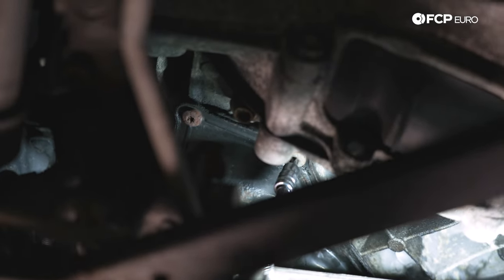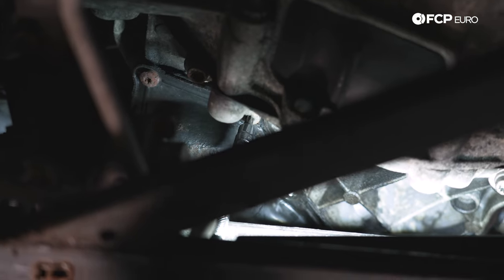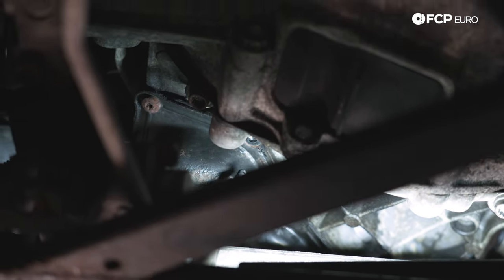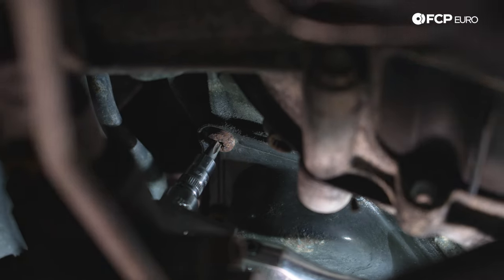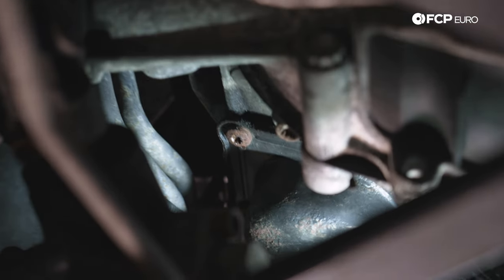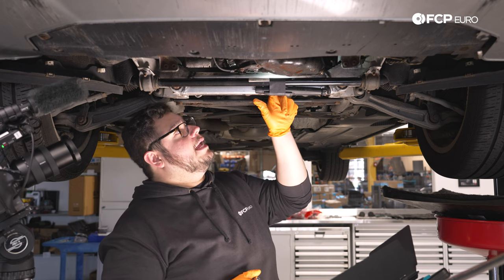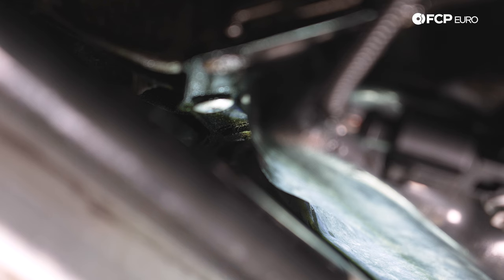That's one out. We're going to work on this back one here next. For whatever ones I can get to, I'm just going to use my electric impact if possible — making sure that the bit is situated first. We're switching over to a three-eighths drive ratchet with an adapter to a quarter-inch, so we have the girth from the three-eighths drive ratchet to break this T30 free. The three-eighths ratchet had the bit of power that we needed to break that free. I'm going to use the electric ratchet to zap it out. We're equipped with a mechanical rack, so we have some wiggle room between the subframe and the rack to get our small extension through.